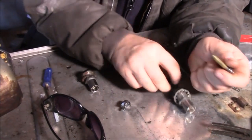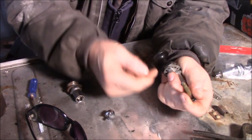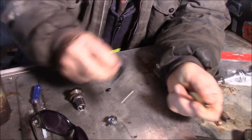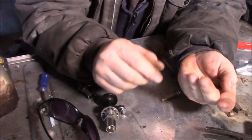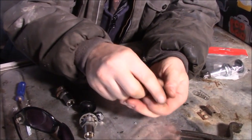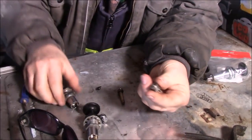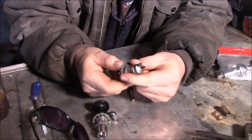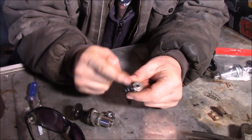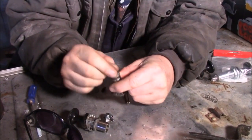So usually when you draw this and when you push on it, if you get gas coming out around this part here, usually the O-ring on this is no good. That's what happens. So the end of this goes right in here, okay? That's how they typically look like this. Fuel usually gets sucked through the one on an angle and it gets pushed out through the straight one.